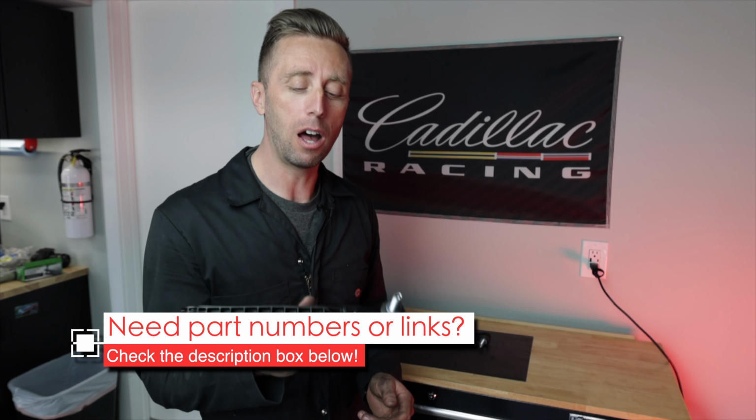So these attach to your strut on your car and the other end to your sway bar, and it's important that these joints are still intact really well, because if they're not, there's gonna be play and that can result in clunks in the suspension. So these ones are nice and fresh, they move smoothly, there's no play in them, and I think it's about time to do that. I have 85,000 miles on my car. I do hear in the left side maybe a little extra noise when I hit those reflectors in the middle of the road, but I don't know if this is gonna help. Either way, it's a cheap replacement, just gonna refresh.